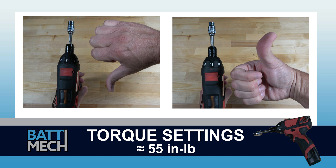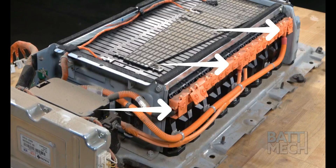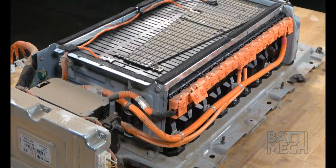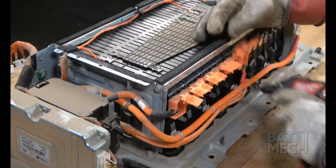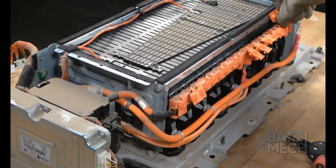If you don't follow these torque settings, you are likely to damage the terminals on the modules and will void your warranty. Never use max drill settings, and never use an impact wrench. Before we continue to the next step, be sure these four wire eyelets are positioned in the correct locations as shown, before attaching the nuts. Also, be sure that you have clipped the wire harness back in and onto the battery modules as shown. After you've secured the wires to the bar with a zip tie, move to the other side of the battery pack and attach the wiring harness to the modules using the nuts. When attaching the orange wiring harness, it will re-energize the battery.